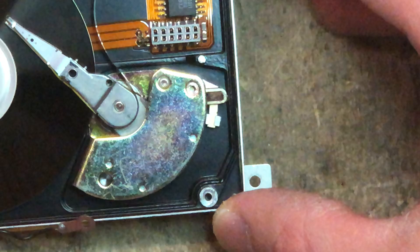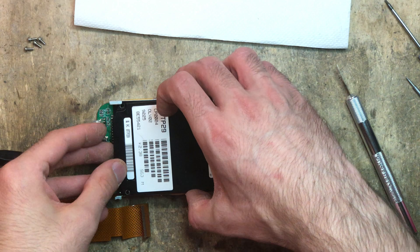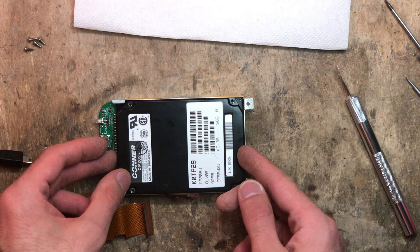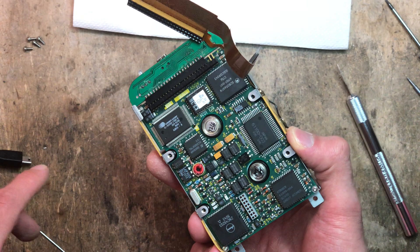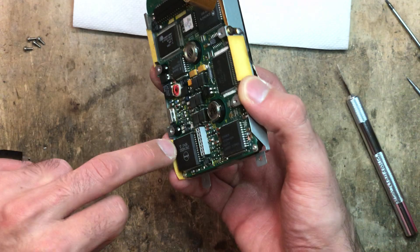All we have to do now is reinstall the cover, tighten all the screws, and mount it back inside the laptop. You just have to follow everything in reverse. One pro tip: most Quadernos have broken hinges, and all the plastic material falls underneath the drive. Some of that is conductive, so take an inspection around — especially where the sticky bits are — and make sure there are no plastic residues, because that can short the board on the drive. Another video will follow up with the logic board repair, but for now, thank you for watching.